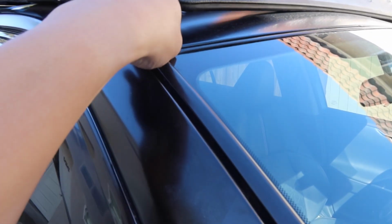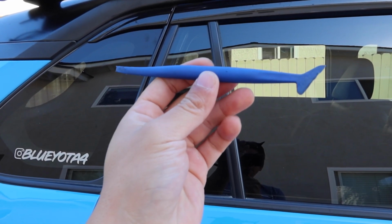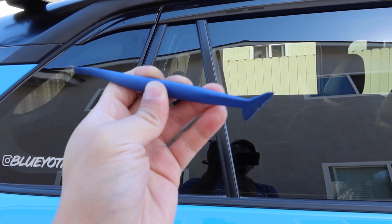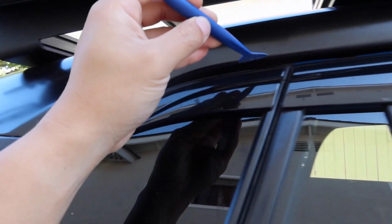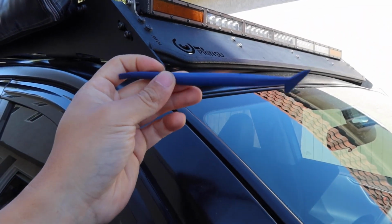For the front up here, along the rubber weather stripping, it's very easy to just kind of tuck the plastic in. One of the most invaluable tools that I used for this project was one of these. I'll link in the description below where you can get one of these on Amazon, and it's just a simple plastic tool that will help you get into the edges, especially around weather stripping and things like that, to help press down the vinyl around, again, weather stripping and edges where you can't tuck your finger in. I highly recommend using one of these, as well as obviously the squeegee to apply the big flat panels.